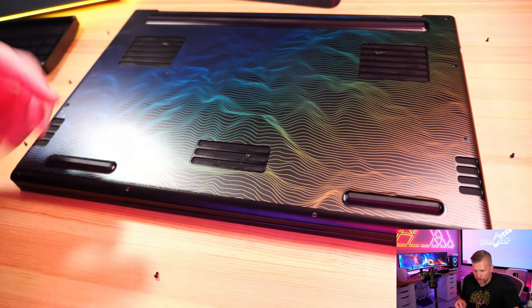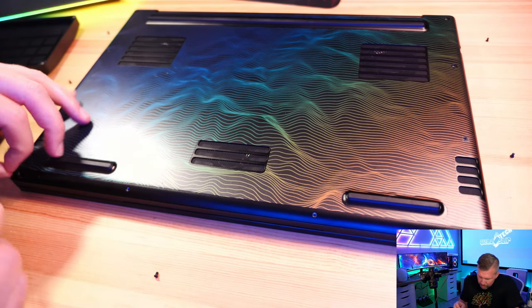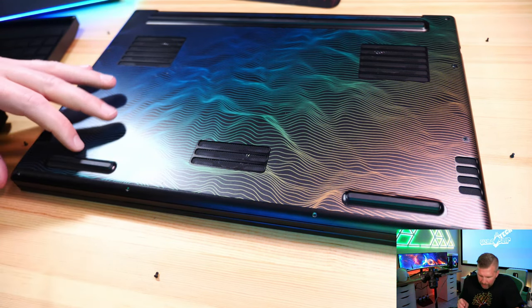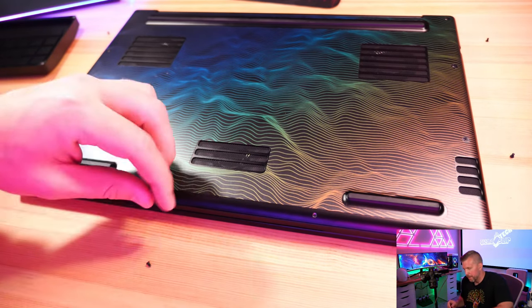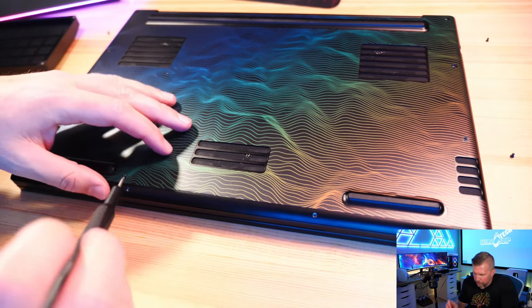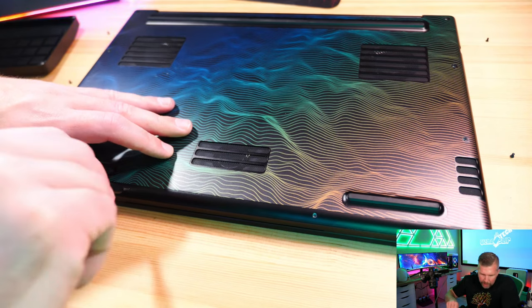All right, so let's get these screws all back in. These T5 screws can be a little finicky to put back in. But I do like T5 screws because you know that you're pretty much never going to strip the screw, because the T5 screwdriver basically never skips a beat. It's always going in there perfectly in sync.